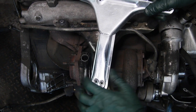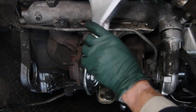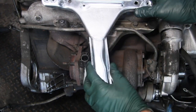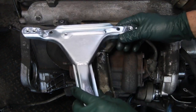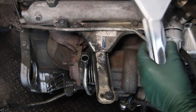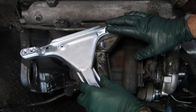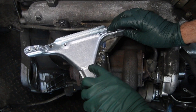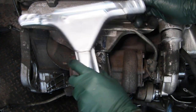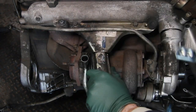This takes some modification on our part to make it stronger — we weld right here, we also come in here and tack weld here, and then we custom fit each one because we found that a lot of them the holes between here, here, and the one mounting hole down here often don't line up. So every one of these heavy duty brackets that we sell has been reinforced with three extra welds and we've custom fit each one to make sure when you receive it, it's going to fit right on your turbo diesel engine.